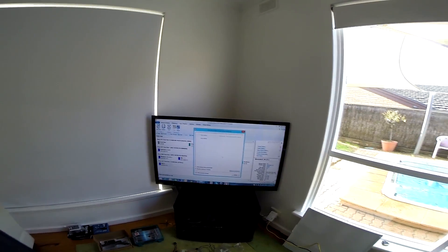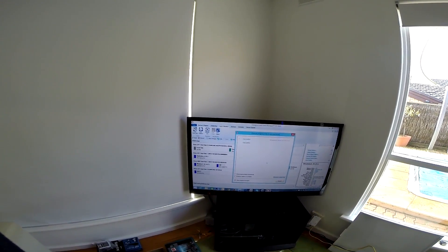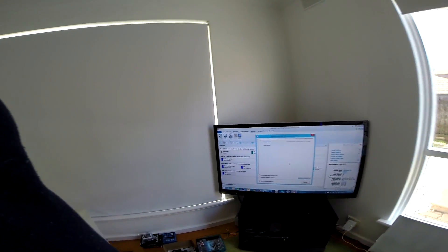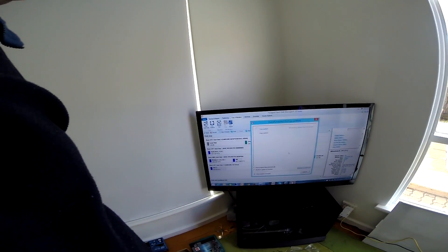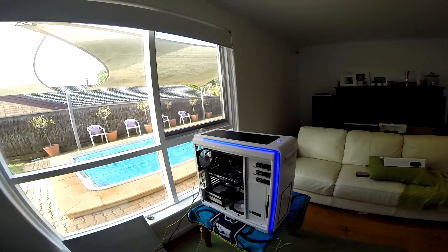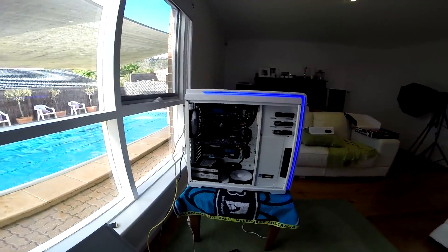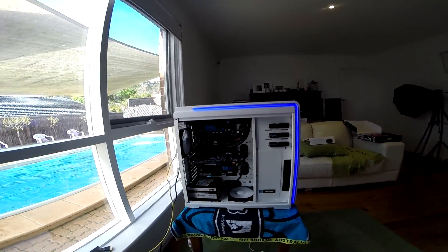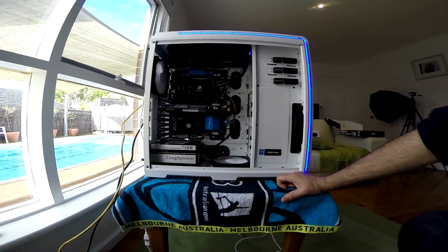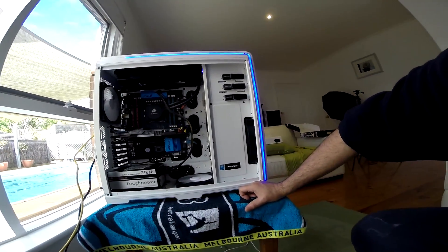Everything is sort of happening — just starting to restructure my disks and partitions. Trying to restructure things so I've got maximum efficiency in terms of where I've got the partitions stored on which of the various drives I've got. And then I'll come up and create another RAID 5 or RAID 10 with the three disks that I've been able to free up. The computer is ready. I'm still running it off a normal SATA drive at the moment rather than running it from the M.2 drive, which is down there somewhere under the video card but not being used at the moment. That will be the last process — I'll clone the OS starting disk onto that one.